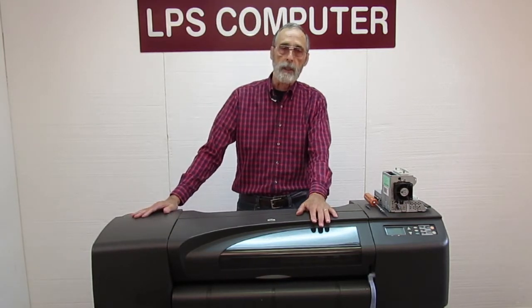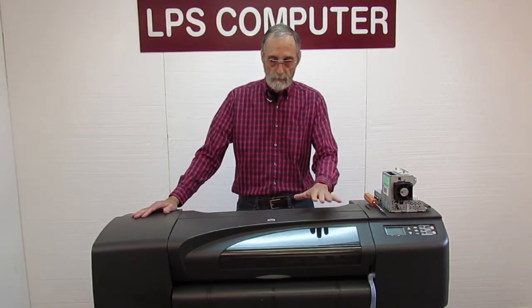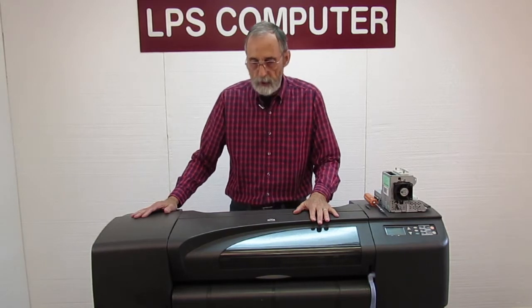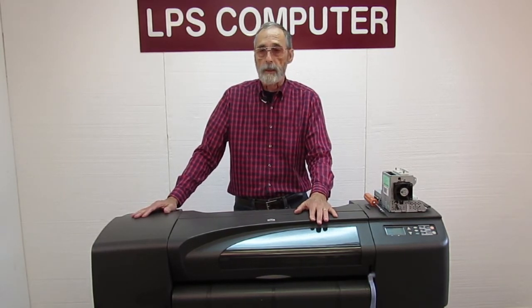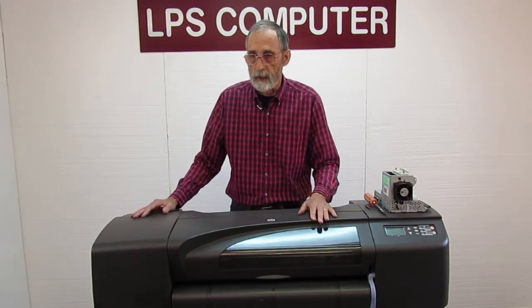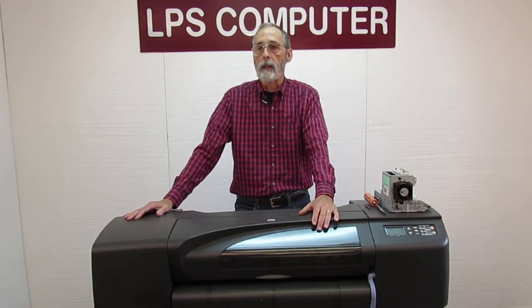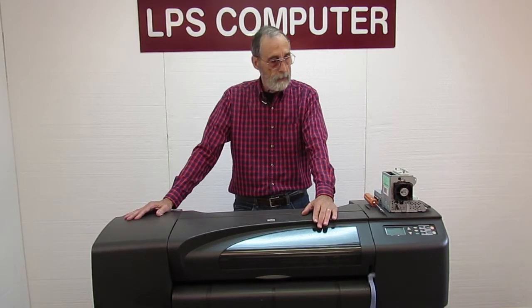And if you still get the 7904, then you know it's not on the computer side, it's on the printer side. The things that will cause 7904 in a printer, many times I've seen third-party ink cartridges do it. They have a smart chip on it, and I guess they're not that smart, and they cause problems. A defective chip on a print head will also do that. Those are the primary reasons.